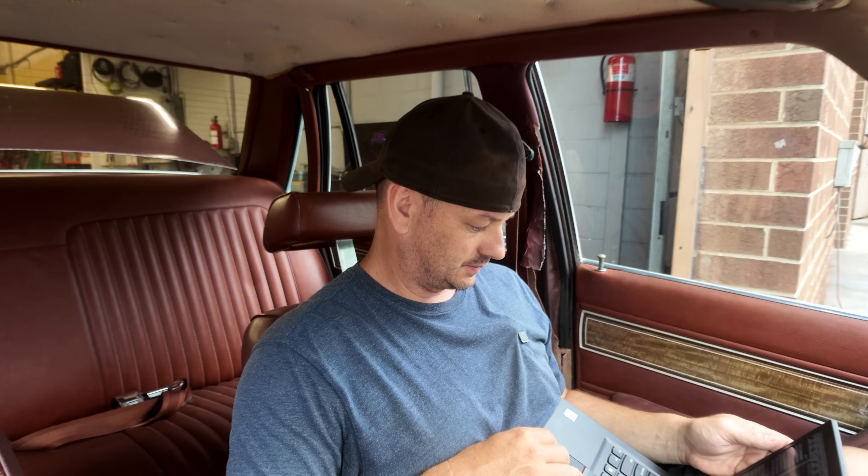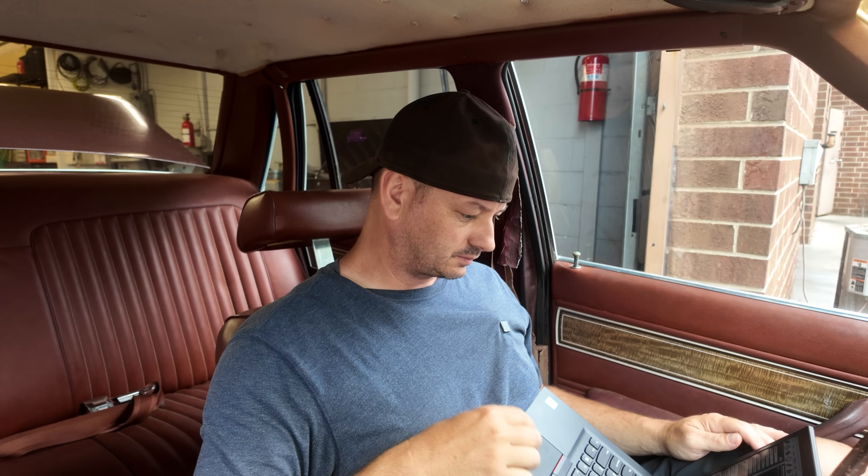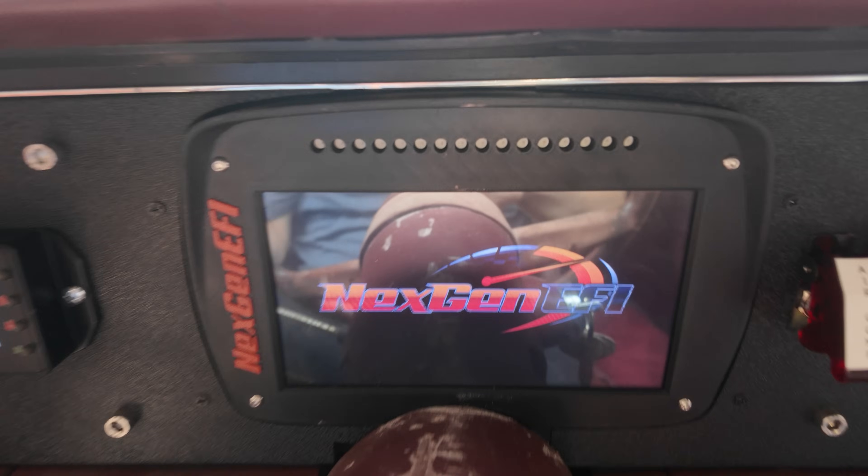The auto fueling has been fighting me a little bit but I think it got it pretty close now. If you want a deep dive on how to use your Holley EFI system, check out the link in the description — it's a brand new website with way more information than ever before. It comes back to idle real nice, so I'll keep tinkering with it, but I think it's time to start doing some full throttle runs. Let's try and make our first full throttle run. I've got my targets running real fat and it doesn't have any timing in it. The throttle body on this thing is super stiff — you gotta really hammer down on it to get it to go.